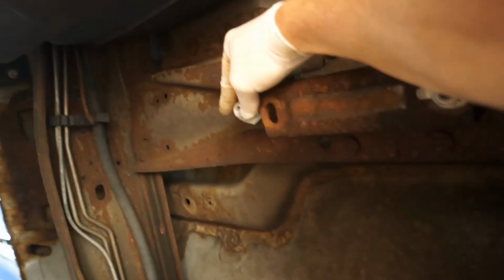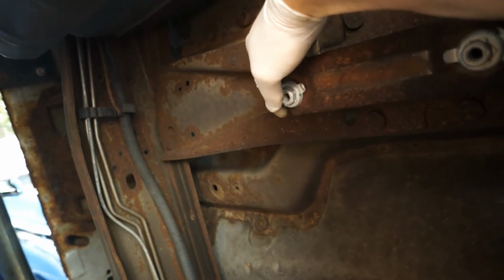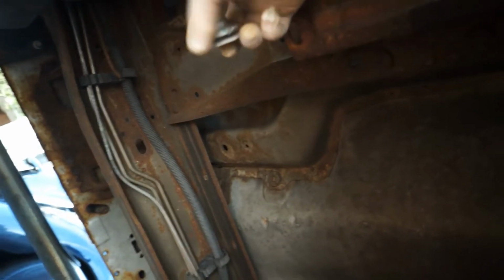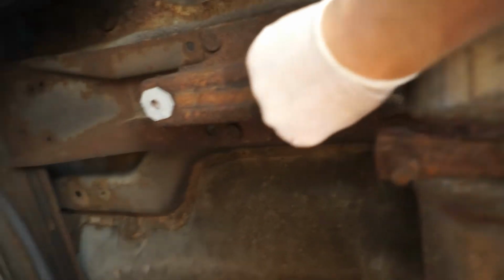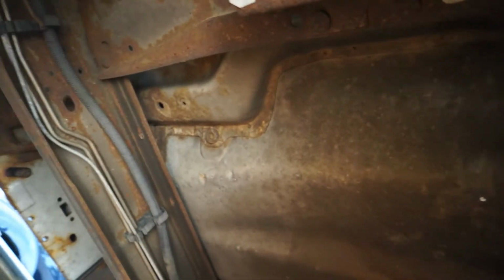I'm running out of time and camera memory here. And they just go right on there. I remember in the beginning of the video I started talking about just swapping these out, but you know what? Actually, I got these backwards. And the nuts got to go up top there. That way you don't have to hold it with a wrench. June's not here, and that's going to save me a lot of time and effort right here. So let's just get those flipped back around. They're galvanized, and they'll hold up. They'll hold that carrier bearing, so I can install this thing myself here.